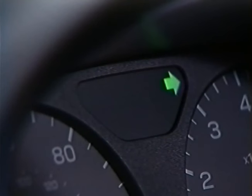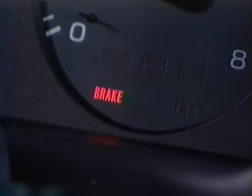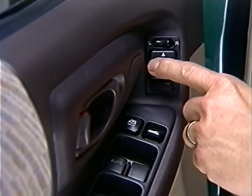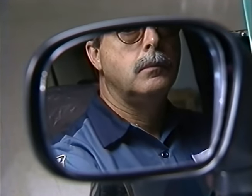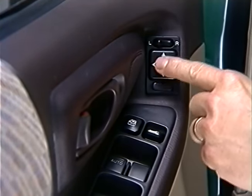Back in the vehicle, turn the ignition switch on and operate the turn signals. Do the turn signals and the turn signal lamp indicators work? Set the parking brake — does the parking brake indicator work? Next, check the operation of the remote power mirrors. Make sure the mirrors move left, right, up and down. Check both the left and right mirror controls as well as the center off position.